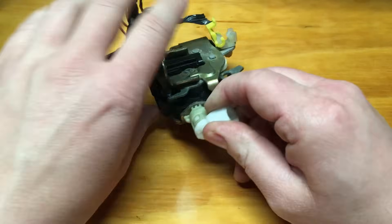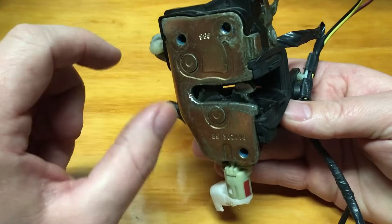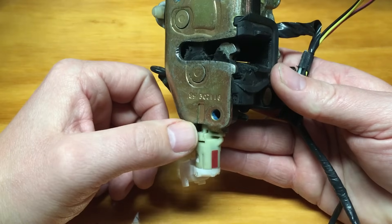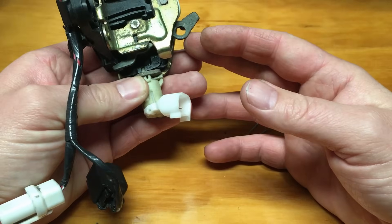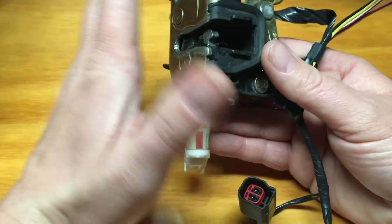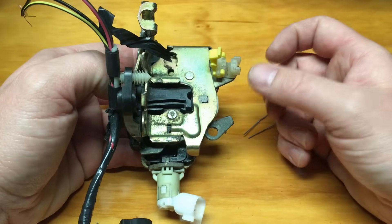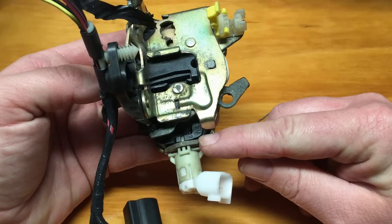Now let me show you how to take this out. These three bolts right here are T27s and they bolt to the door skin. Your latch goes in right there. You can't just take this off because it turns clockwise, which means it flips out this way — but the door skin is right there. So you'll need to pull the latch off with a couple T27s, unclip some latch brackets, and get it out.